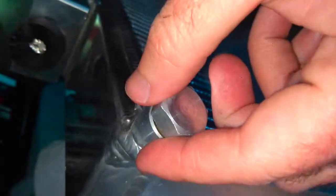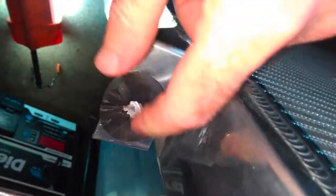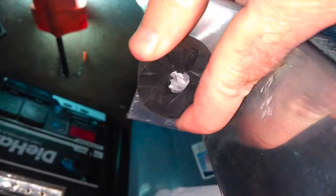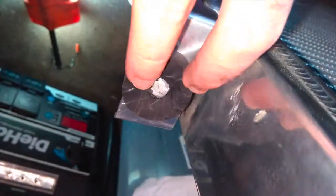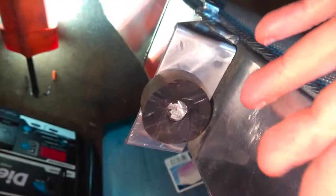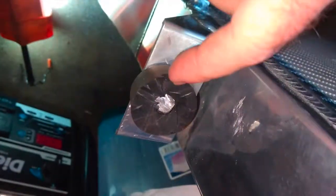Even then, there's some tight clearance between the drain system here — this drain plug — and actually the power steering lines, which is pretty telling. So it's a much beefier radiator, and you will have to do some modifications to the rubber pads on them. But I'm going to go ahead and try to fit this on now and make sure it's all level and good and clip it in nice and tight, and then continue with the rest of the coolant system refresh — which means putting on the rest of the pipes in the front, and maybe in a future episode doing a leak test before everything goes back on. Step number one: this radiator has to go in. Here we go.